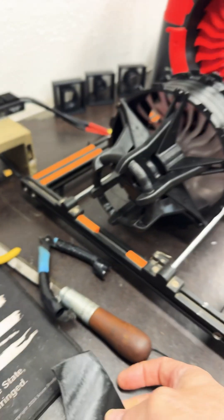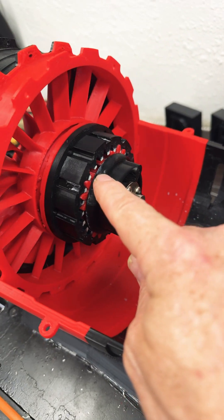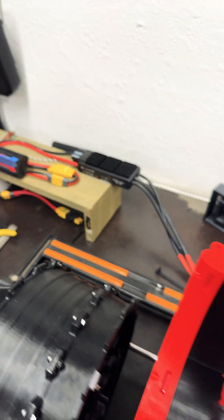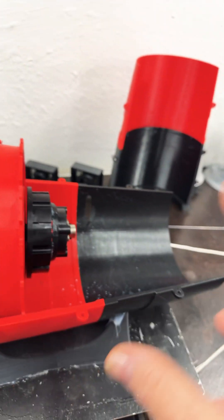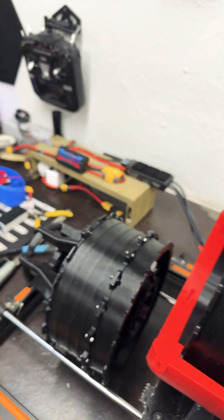And it'll still be driven by a 4 to 1 gear ratio, except this time with a 60 horsepower motor. Isn't that fun? And a 48 volt ESC with 150 amps, which means I won't push the full 75 volts that this motor is rated for, but it'll keep it within safe operating ranges as far as heat and blades flying everywhere.